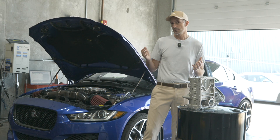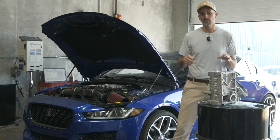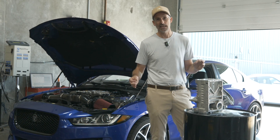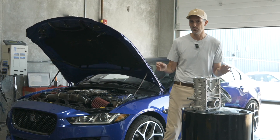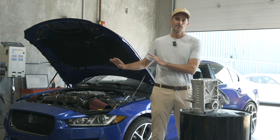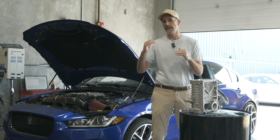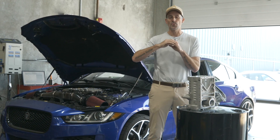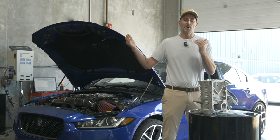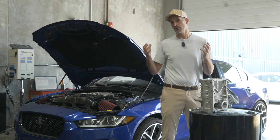There's some level at which it doesn't make sense to, for example, fit a much larger supercharger onto a V6 F-Type if you can just buy a V8 version of it. Pretty much the only thing that JLR didn't put the V8 into in practical terms is really the XE. They did technically put it into the Project 8, but that's a $250,000 wide-body car — not really a normal version attainable for most people. I've even seen some people comment that you can't put the V8 in these, but our dealer in Kiev has done it and we've tuned it — it's eminently doable. That's the headroom you have in terms of price comparison, where it doesn't necessarily make sense to spend $10,000, $15,000, $20,000 getting a much bigger supercharger onto a V6 when you could potentially get a dropout engine or just sell your V6 and buy the V8 version.